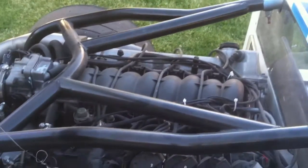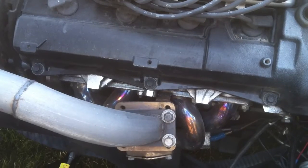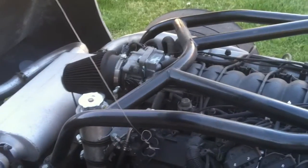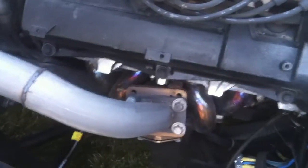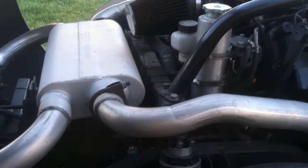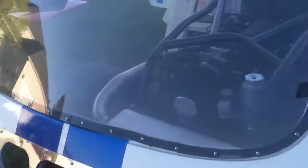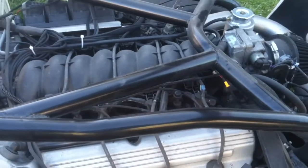The engine is basically a bone-stock Cadillac Northstar, with the exception of the headers, which we fabricated. The fuel injection system is not stock — it's a Holley HP EFI system, fully tunable and programmable. One feature on the headers is the flange is for a T3/T4 turbo. My original intention was to put twin turbos on it after I learned to drive it with the 300 horsepower it makes now. With a turbo you could jack it up to around 500. You could also get it to 400 by doing a cam swap, which would also require bigger injectors. A cam and valve spring swap will get you to 400 with that 8,500 RPM redline.